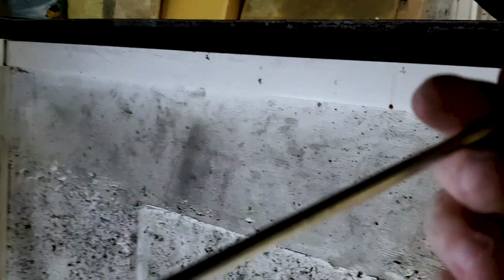Alright, so now on these new Ford Focuses, you have the usual under tray. So you've got 3 bolts along the back. 1, 2, 3. Then you've got one just under the front bumper, just there. You've got another 1, 2, 3 there, and another one just under the bumper there again. So for them, you're going to need a T27 Torx driver, either one of them or you can get the bits that are in the socket sets. Just use one of them, get them all off.